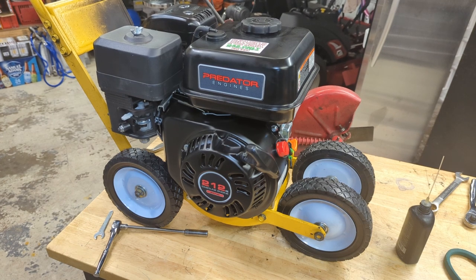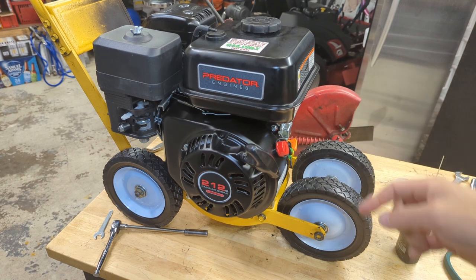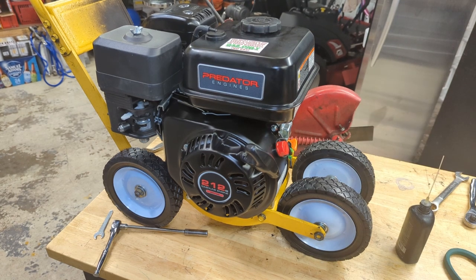Alright folks, I think that's the finished product. This thing is fully mounted, we got an upgraded air cleaner installed, we replaced that old engine — there wasn't anything super wrong with it, but the way the fuel tank mounted to the side of the motor was kind of flawed, and here it's actually a much better design. Unfortunately it's a bigger engine so it's going to consume a bit more fuel. It's a six-and-a-half to seven horsepower engine on a lawn edger that normally comes with two or three horse — very much overkill, but it'll work. If you like this video, please subscribe. Stay safe, thanks for watching everybody, take care.